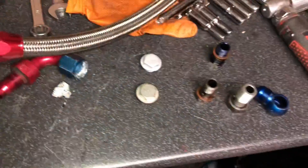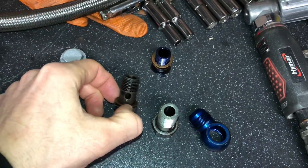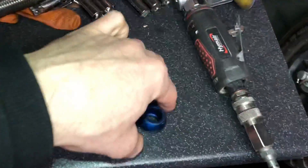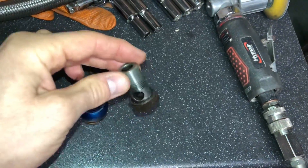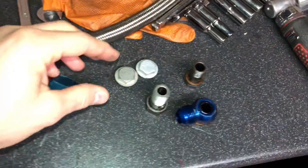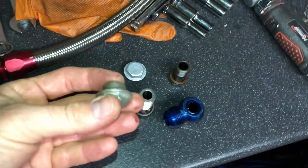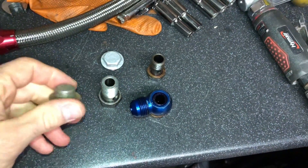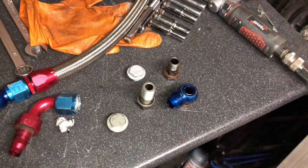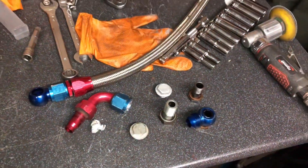I'm going to order a new fitting. The other issue I've found is that we changed the oil filter housing — it looks like we had an Evo 8 housing which runs a smaller M16×1.5 thread banjo, but the new one has M18×1.5. Luckily I had some old lambda sensor bungs that happen to be M18×1.5 — exactly the same thread. I'm going to fit copper washers on one of those to bung off the oil filter housing so I can start the engine, get oil pressure up, and confirm everything is good. The oil cooler can be fitted at a later stage.